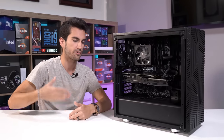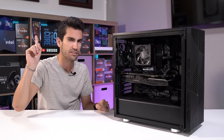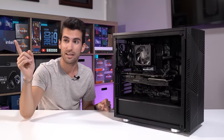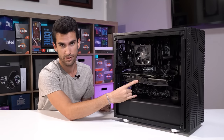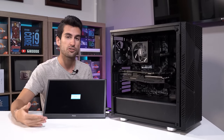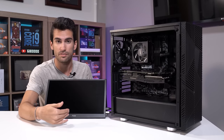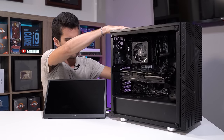We're going to plug this into my portable monitor first, attempt to replicate the issue described by the viewer. And if we do, in fact, get no picture out from the graphics card, I think the first thing I'm going to do is swap this graphics card out with my personal graphics card to see if this card runs in my own rig. And if it does, then we've ruled out one of the potentially more catastrophic hardware failures in this build. Nobody wants to hear that the graphics card has died in 2021 — talk about bad timing. It is always important to test drive the build. When a viewer describes something going wrong, you need to make sure that what you see in person is the same thing they're describing. So I'm going to connect power here and flip the switch at the rear.